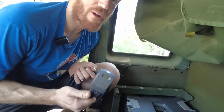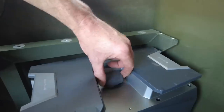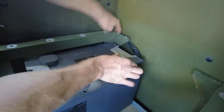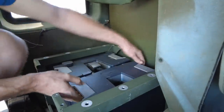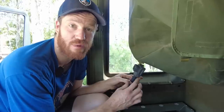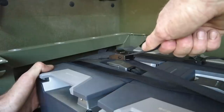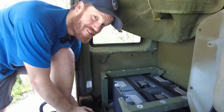These pre-made cables are super cool — no figuring out wire gauge size, no crimping connectors together, no guessing. It's just already ready to go. The system runs on 48 volts, which allows the wire size and all these cables to be way smaller than a 12 volt system, which means easier routing and easier cable management. The batteries are very secure — way more secure than the batteries in our camper.